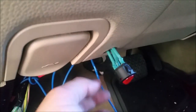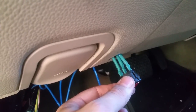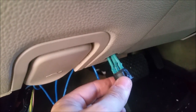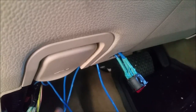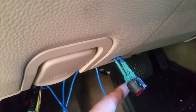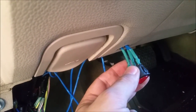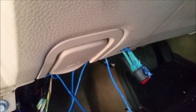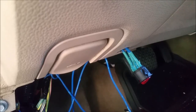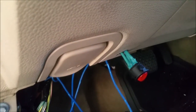This is totally extra — I wanted to be able to watch movies with the car completely off, without having the key in the car. It's not designed to do that because you can kill your battery, and it's not really a great idea, but I want to do it anyway. So basically I just soldered and heat-shrunk this switch in. It will run 12 volts into this switch with constant power, then the accessories connect to the output on this switch. When you flip the switch it turns the accessory on, so the screen won't turn on automatically when the car starts, but you can use it when it's off.